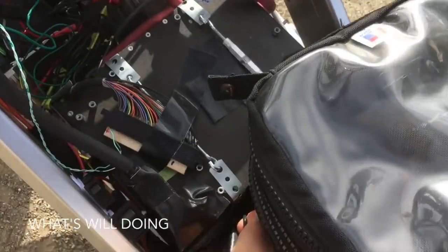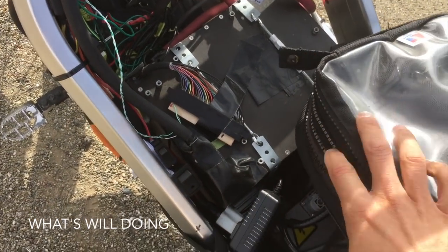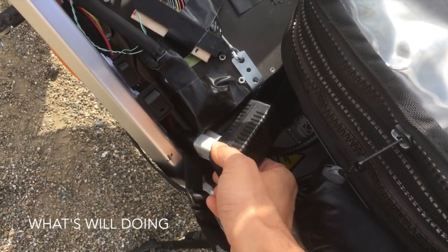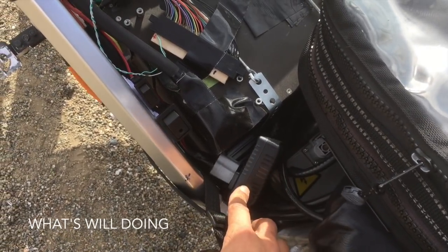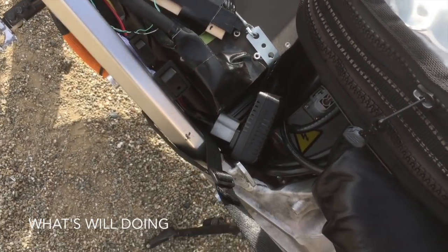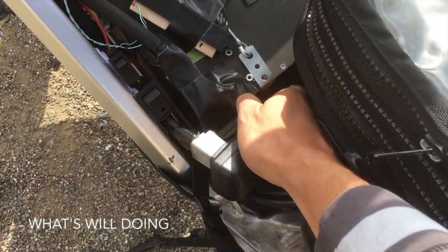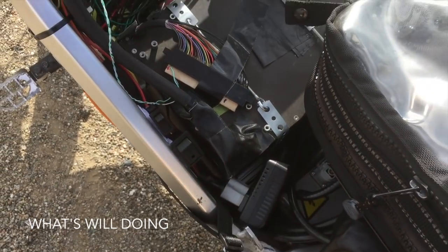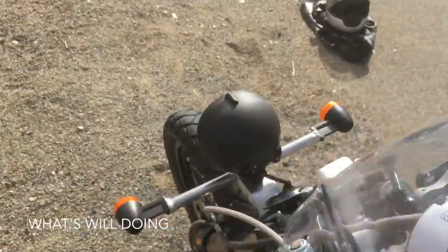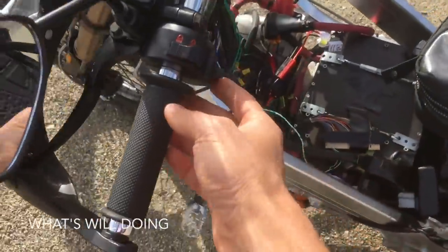I've got this power supply right here. Because my batteries are about 110 volts, this power supply — which is made to run on AC 110 or 120 — it still works. It's just taking DC instead of AC; normally it would chop off half of that AC sine wave and give you DC, but with DC input it doesn't have to chop anything. So far it's been working well. That power supply runs the speedometer and my lights — I've got headlights, turning signals — and it runs the horn too.